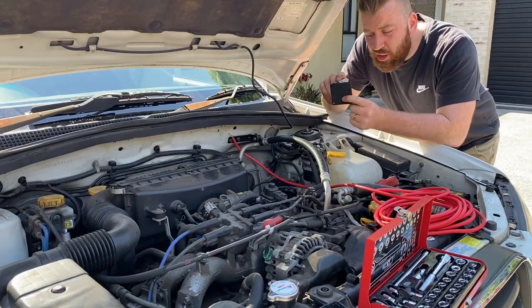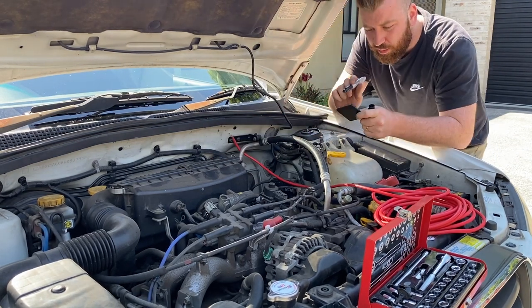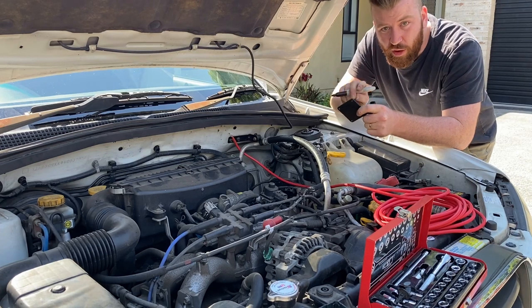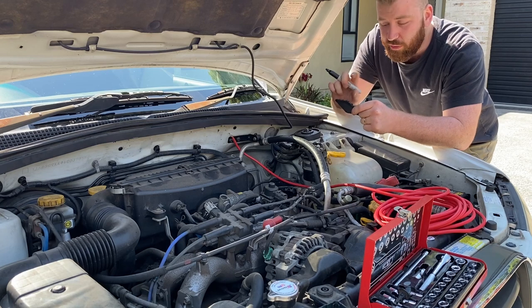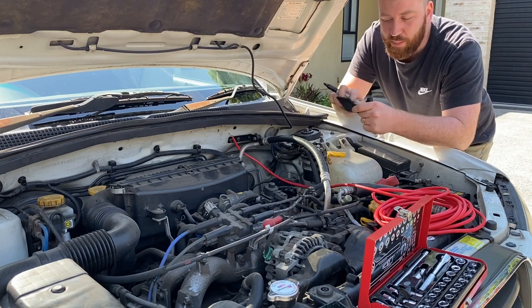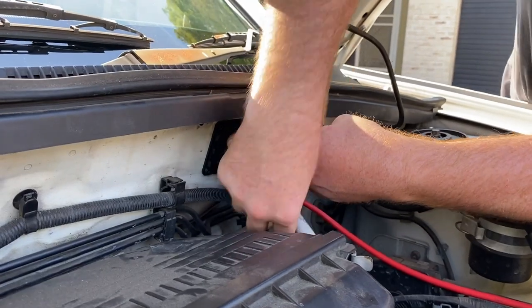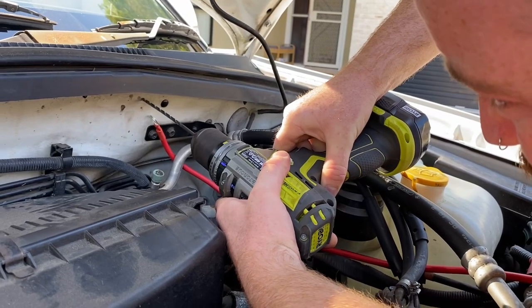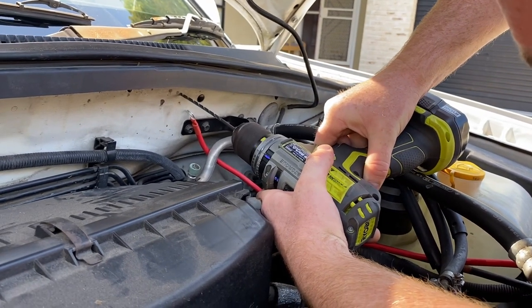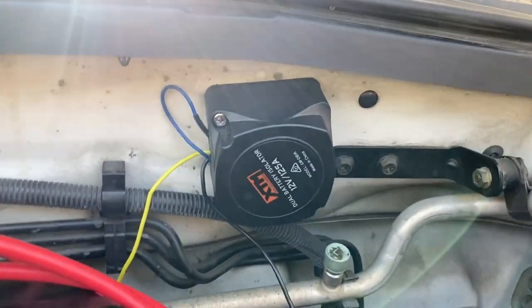What I'm going to do now is use a marker to mark out where I'm going to put the screws, drill those holes, attach the screws, and then we'll be able to attach the voltage sensitive relay to the back plate. Then we can start on the wiring. There we go - got our four dots so we can get a screw through. So we've got our dual battery isolator in, mounted up the back of the engine bay.